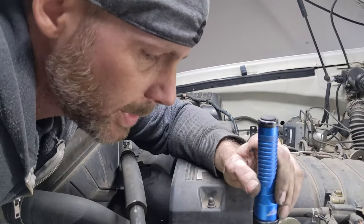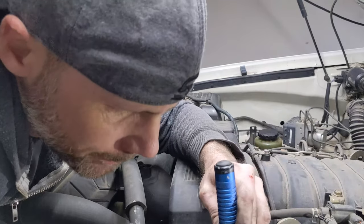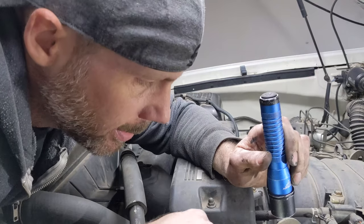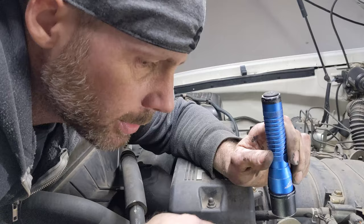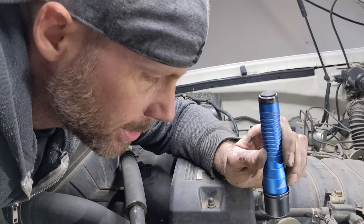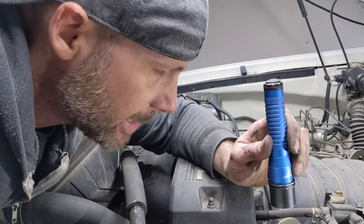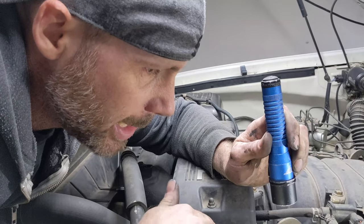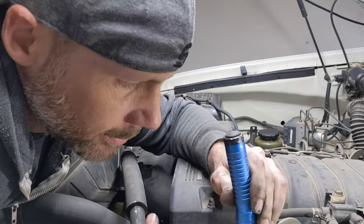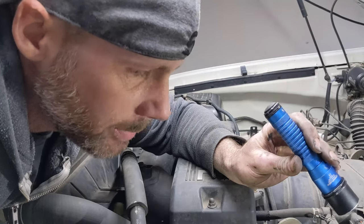If you can't find a torque spec, use the rule of thumb that I gave you. Otherwise, it's a good idea, like I said, to recheck the torque. As time goes on, the rubber will compress on the gasket and on the rubber grommets, so you will want to retorque those. If this is your car and you have access to it, retorque those maybe after 6 months, and then again, check it again at a year, just to make sure that they're torqued properly. That way you don't have any premature leaks.